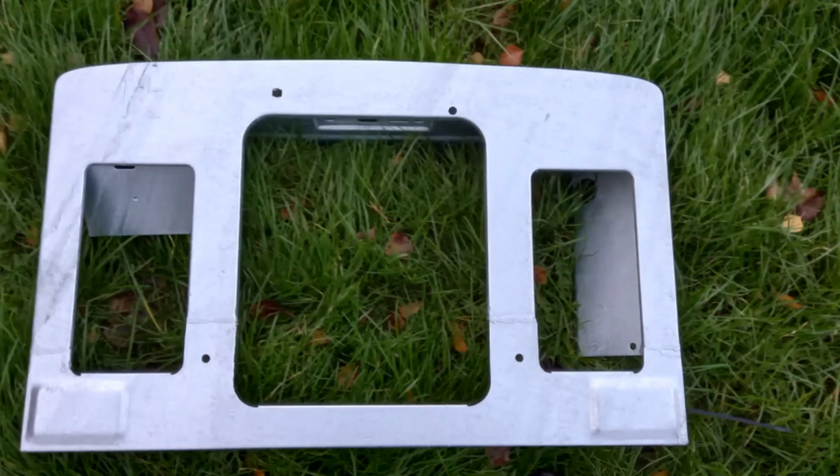And that's it galvanized. It looks fantastic. Now you can see in the corners on the right hand and the left hand side where the weld was, I really went to town on the grinding to get rid of that weld. And you can see there's a change in colour, but you can't feel it. So there's just enough room there for a wipe of filler, which I'll do in a moment.